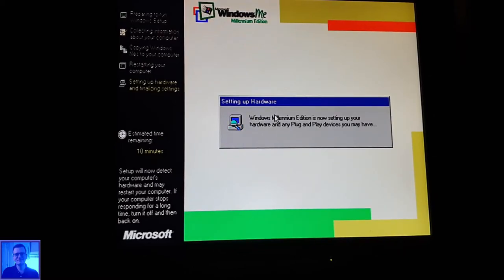There was a moment, like maybe an hour ago, that I thought to myself, "Oh, I cannot even speak. Wait a second, rewind." There was a moment I could not even think that this would work, let alone that the computer would start, because there were a few factors in my mind: are the connectors on the system panel header correctly oriented? Is the power supply unit okay? Is the SSD okay? Is the EIDE to SATA converter okay? All those little things that can have any influence on it.